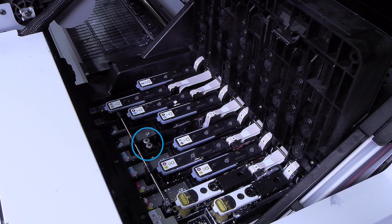The FI tower, indicated by B, is the structure into which the printhead (A) is inserted, and through which the ink arrives at the printhead. Whenever you remove a printhead, check whether the FI tower has a lot of ink on it. If so, clean it with a lint-free cloth before inserting a new printhead.